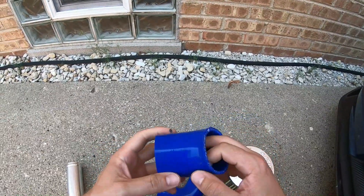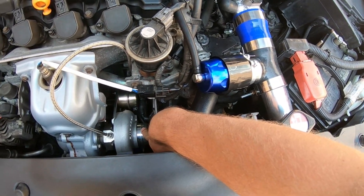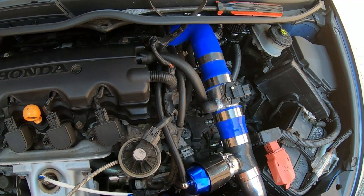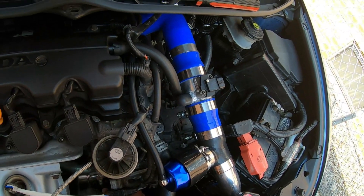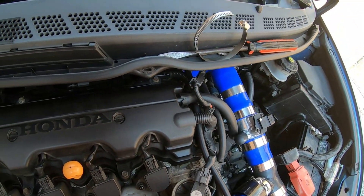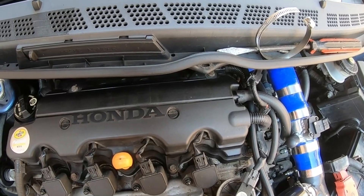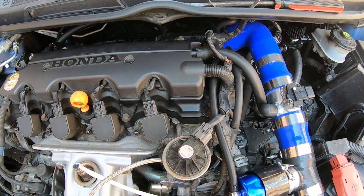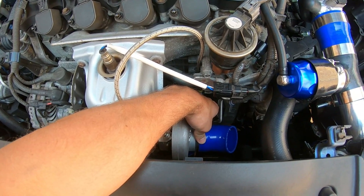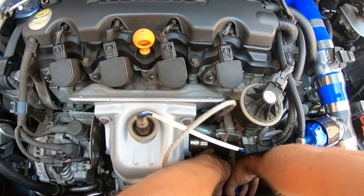First, take the half-cut coupler — it's two-inch — and our turbo inlet is about 2.25 to 2.3 inches. You can actually stretch this coupler onto the intake portion of the turbo with a little elbow grease. If you want, spray some WD-40 on it to help — it slips on and it is really tight. I've been running the car without a clamp on the turbo and the clamping force alone holds it well. We're going to clock it a certain way that will be beneficial for the next pipe.